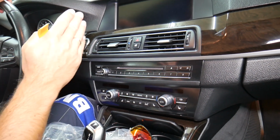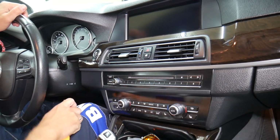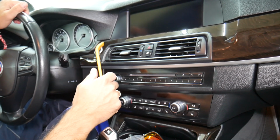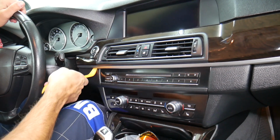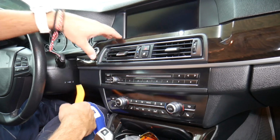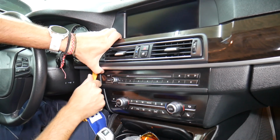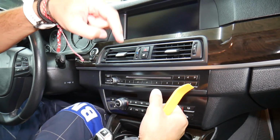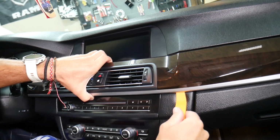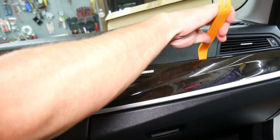Now it will be recommended to disconnect the car battery because you will be disconnecting the engine start and stop engine switch and other components as well. It's very important to know on BMW which battery terminals to disconnect first and which one to connect first, because otherwise you can burn modules and computers that can cost you thousands of dollars in future repairs. Now we'll put a link in the description of the video below that explains which battery terminal to disconnect and reconnect first.